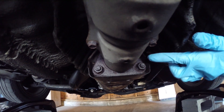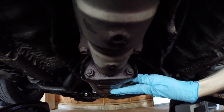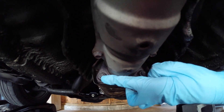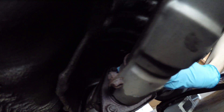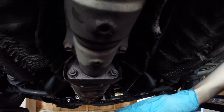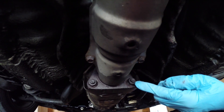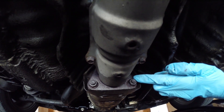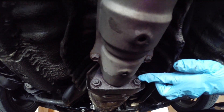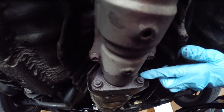The first thing we'll need to do is take off the three nuts holding this piece of the exhaust to the catalytic converter. There are three nuts: one here, one here, and one up top. We may end up having to take off the exhaust heat shield, but I'm going to see if we can take these off first. I soaked these down in some penetrating oil last night since they're obviously quite rusted. We'll see if that works, and if not I may have to either cut them or heat them up.